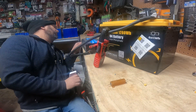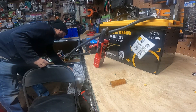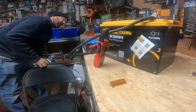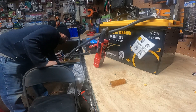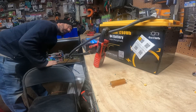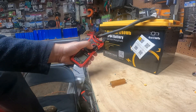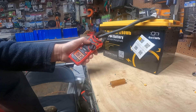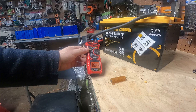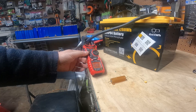Let's turn this guy on — oh, it is on. So I'll turn on a load. I'm going to turn on a space heater. We've got 580 watts right there. Turn it up. So we're at 900 watts. That may be all we get. We've got 83 amps going through it, so not what I wanted. Not much of a test, but it can at least do 80-85 amps pretty easily.